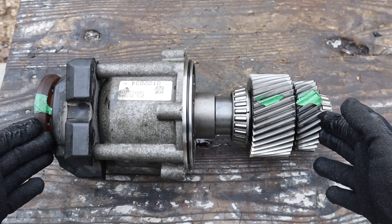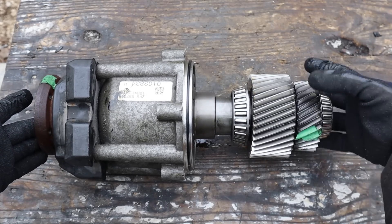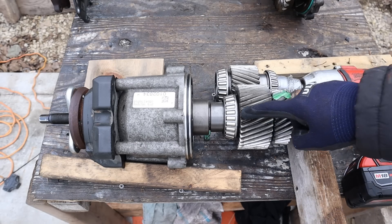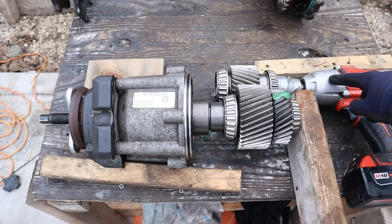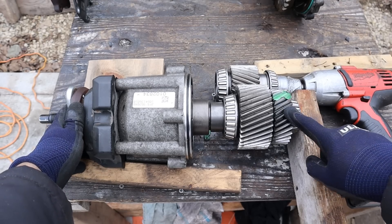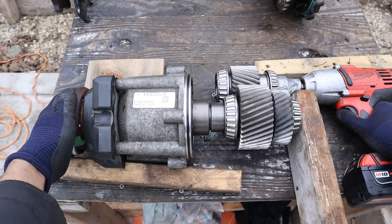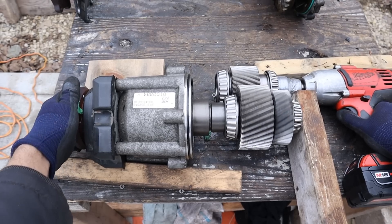Let's say we're going around a corner — you don't want the all-wheel drive system to bind, which is why you need differential action between the front and the rear. If I apply a little bit of resistance and rotate the front axle, you can see it's allowed to rotate a lot faster than the rear axle. I've devised this jig so we can visualize how this limited slip differential works. This is the input gear tied to my impact gun using duct tape. The impact gun provides torque until the hammers start to fire off inside. I'm going to put a little drag on the rear wheels to simulate traction and no drag on the front to simulate them spinning on ice. Normally they spin at the same speed with a 50-50 power ratio. With drag on the rear, I can actually feel the torque increasing significantly on my hand as this speeds up — that's the mechanism trying to increase torque going to the rear wheel.